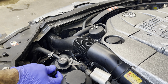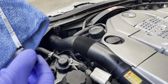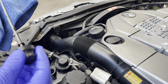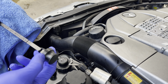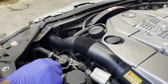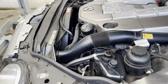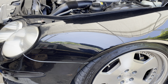Since the engine is cold at this moment — I had the car sit overnight — typically you would want the fluid level to be somewhere around the middle, between the two marks, when the engine is cold. When it's cold it should be here, and when it's hot it should be here. Right now we're just below the cold mark, so I'm going to add some more fluid. This is enough to run it and check for leaks. Now I'm going to lift it up, check for leaks, put the covers back on, and then add fluid after.